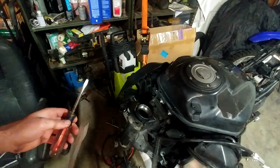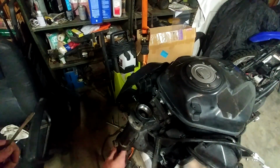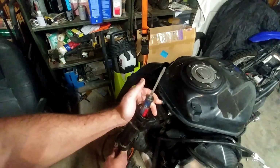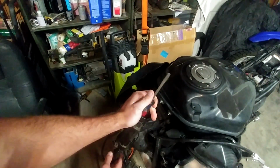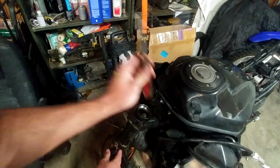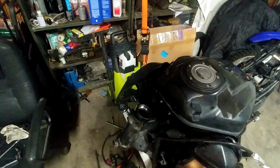I don't have a punch with me at the moment, but I do have tire spoons, and they're not perfect because they're a little round on the lip, but it did work. So I stuck the tire spoon up to the bottom of the bearing race, and I wedged a screwdriver in right there. That's basically what his tip was, and it helped a ton. So once I did that, I could just hold the bottom of the spoon and give it some leverage away from the lip that I'm hitting and just begin to knock it out. And I just did that, alternating faces, left, right, left, right, eventually until it comes up. And it worked pretty well. So there's a tip for that.